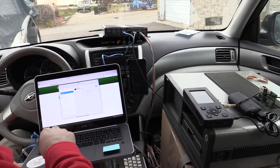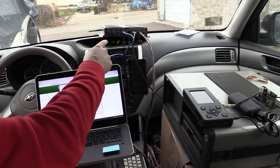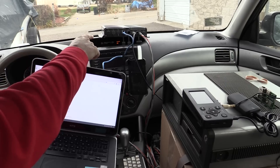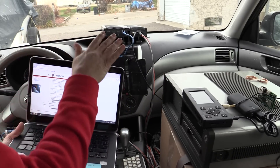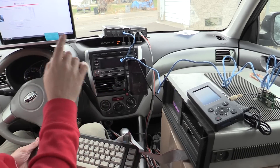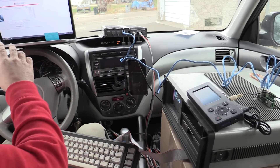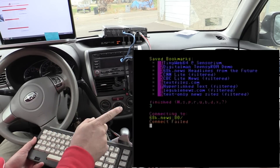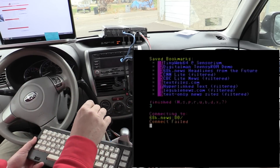We're sitting in the driveway with the car running to power the equipment, provide a magnetic roof for the antenna, and give me somewhere warm out of the winter to do this silly project. I have to remember all my network settings because I had this configured to use another weird satellite modem, so I'm going to switch this back to the same network as the Inmarsat terminal. I had to remember to do HTTP instead of the default HTTPS because even though this modem is much newer than the Commodore, it's still from the mid-2000s — well before all this HTTPS nonsense. I'm going to fire up the Commodore and see if it gets an IP address assigned from the modem. We've now provisioned the IP address for the Commodore to use 32k of data, but our connection failed — something is still a little screwed up.